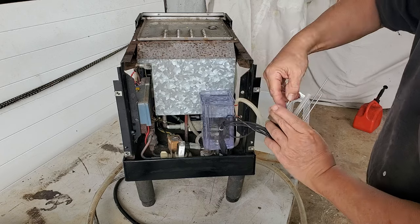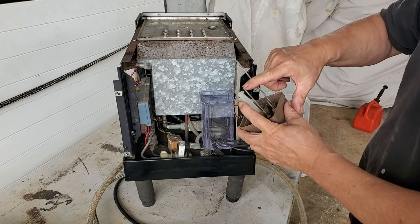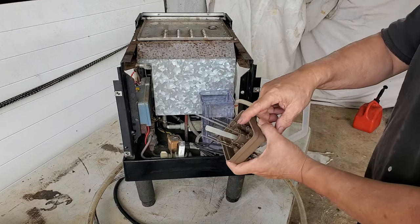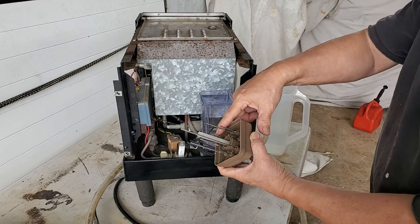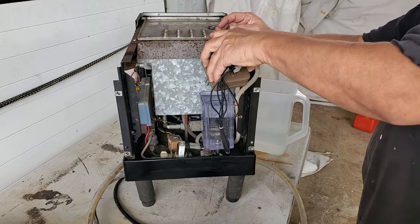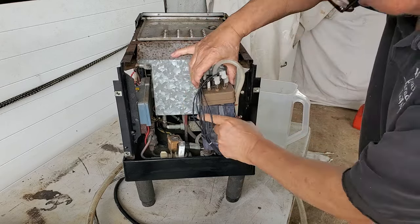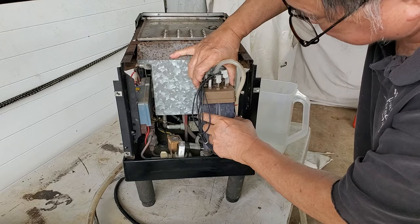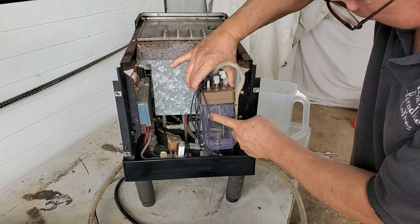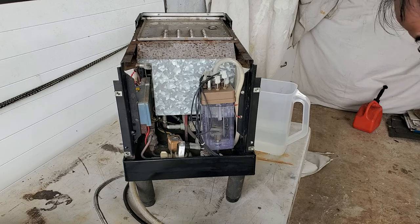The main thing is the tip here is clean. The rest on the side doesn't matter because it senses as soon as it touches the water. Right now this water should be flush with this one right here - it's probably a little too high but that's okay. So I'm going to put this back in - it just clips in. It doesn't need to be sealed, it just needs to be seated flat. You can see water overflowing - it'll go down into this tube.